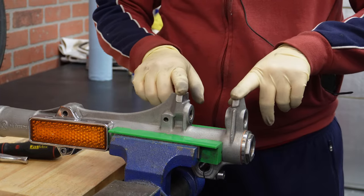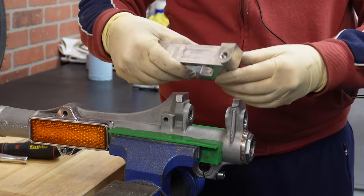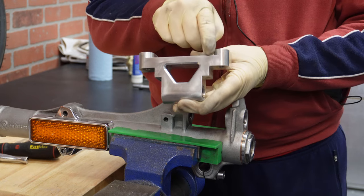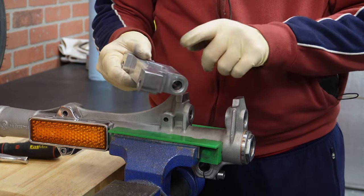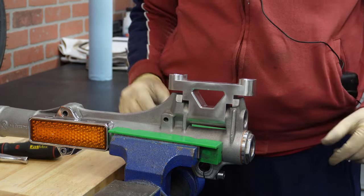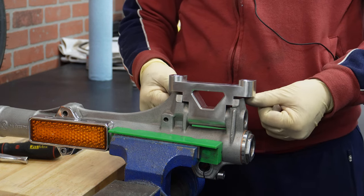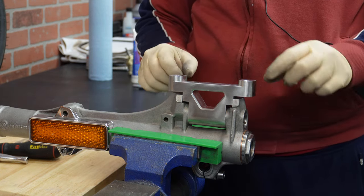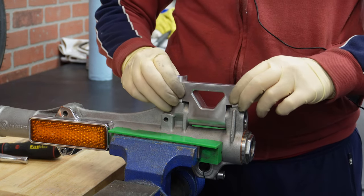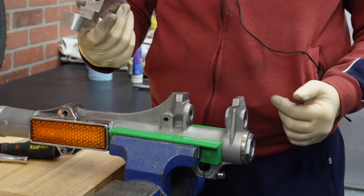Okay, so after cutting and sanding it with sand block, we can actually dry test the adapter. Adapter is directional, so this part is essentially beveled compared to this one, and that faces out. And this is how it's going to be fitted. The reason why you always need to cut it a bit more, not to make it completely flush with the adapter, is so it does have a bit of wiggle here, so you can adjust the calipers properly. Okay, that looks great to me.